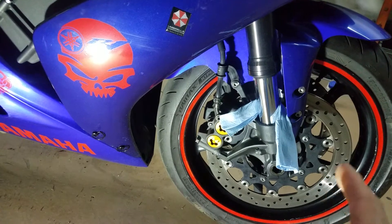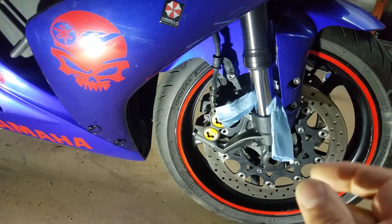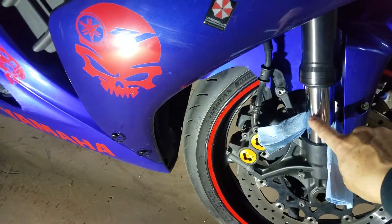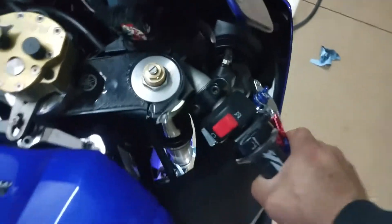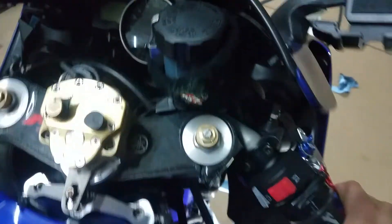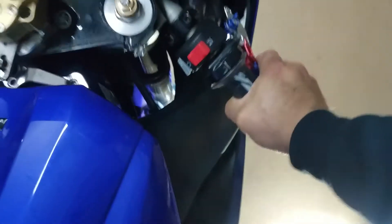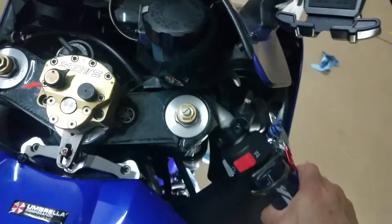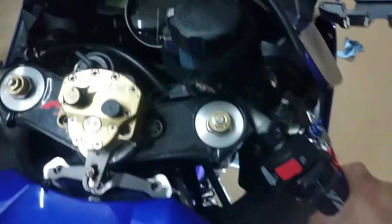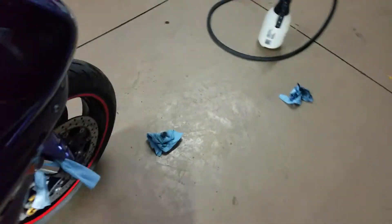Today is 4/15/21, so let's see if fluid is coming out after a few pumps. You gotta do it like 10 to 15 times — you gotta hold the brake and push the handle down so the fork goes up and down. If it doesn't seal properly you will see fluid coming out, but if you fix the problem permanently, you should be good to go for one more season.